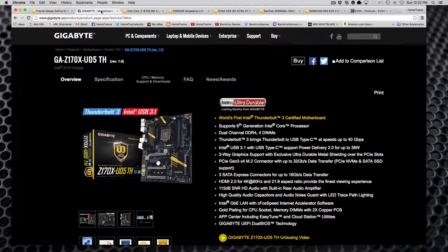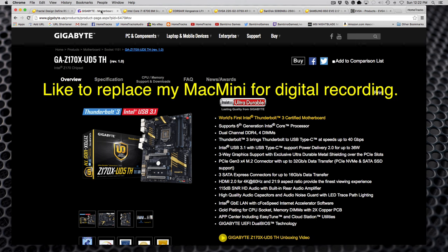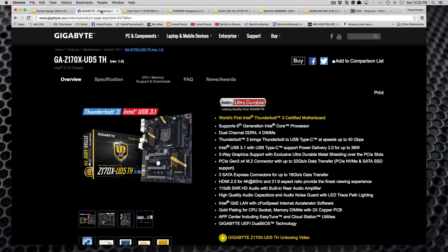The most important piece to me is the motherboard. I chose the Gigabyte Z170X UD5 TH — the TH stands for Thunderbolt, and for $10 more you get Thunderbolt capability. A few things attracted me: the heat sinks look really well made, the audio section is isolated which makes it better for audio production, it has Thunderbolt for video or external drives, and it has M.2 support. For around $189, this board makes a lot of sense.